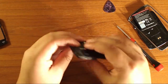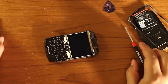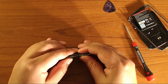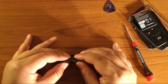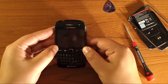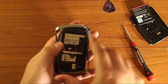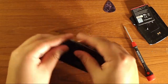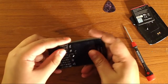Make sure the clips go in both ends — make sure you can see that the clip actually went through. Then you do the screen, which is the exact same idea. Make sure the clips go in; there are a couple of clips on the top too, they're plastic, and the sides here — make sure they go in nicely. Don't push too hard on the LCD, you will break it — just push enough. Then we put the bezel on; the thick part goes in the bottom. Snap the clips all into place until it looks straight and perfect.